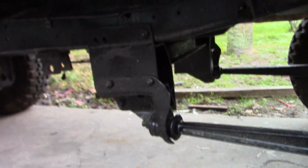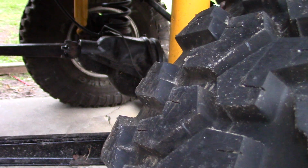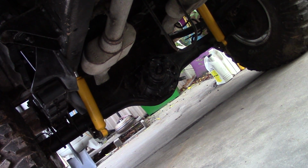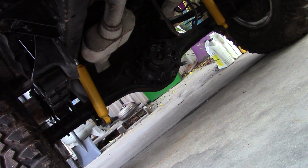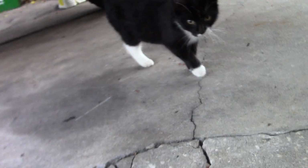Got the drop, high pinion Dana 44. It's been rebuilt. It's got a 355 gear in it, and then it had a corporate 14 bolt in it. We took that out and I built this 9-inch for it. It's got a 355 with a locker, and got to build some wrap-up bars. It's got the front mount there, but there's no mounts on the 9-inch, so gonna have to do something with that. And then the drive shafts, of course, they already, let me get under this thing.